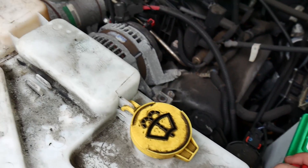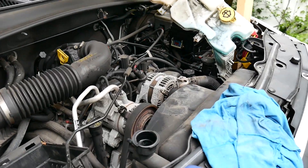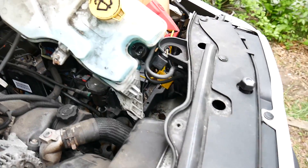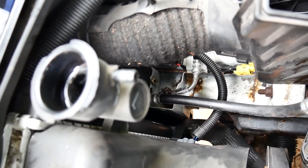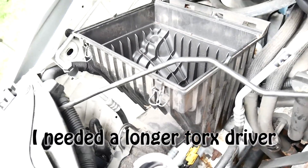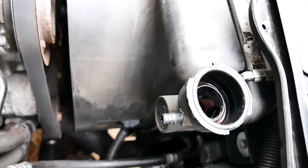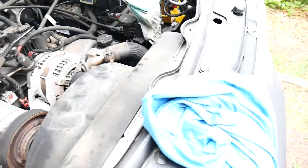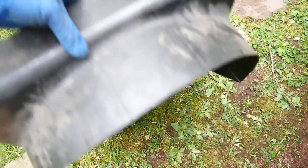I'm sure there's a fan control on the bottom that we'll have to get to. After messing around with that for way too long, I ended up taking the battery out. The horn had to be slid out of the way on this side, and over here was a real bear to get to the bottom bolt because of this air box — I couldn't figure out how it comes out; it's some kind of clip on the bottom. Now we're going to take out this shroud. It looks like there are two 8mm bolts on top and maybe two on the bottom. We have the fan and shroud assembly out of the car — it's all one unit.